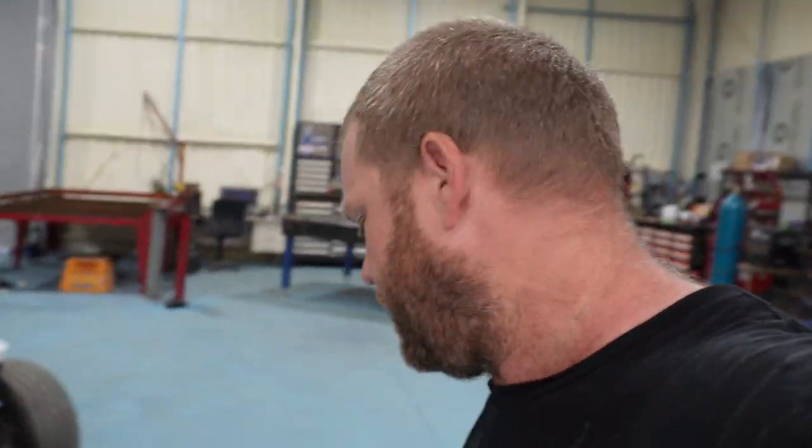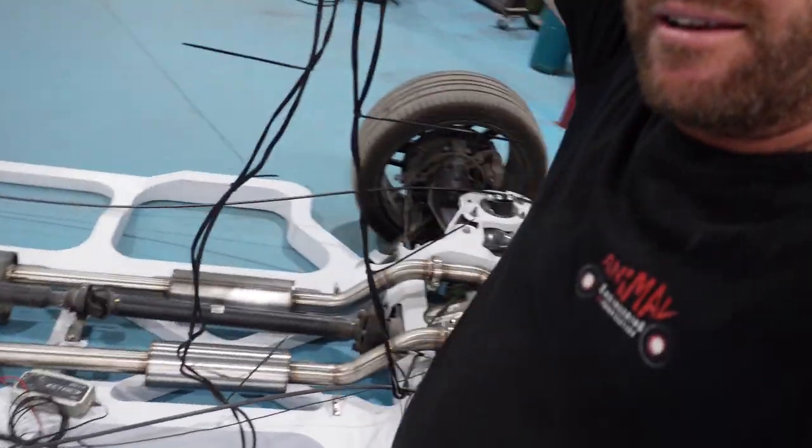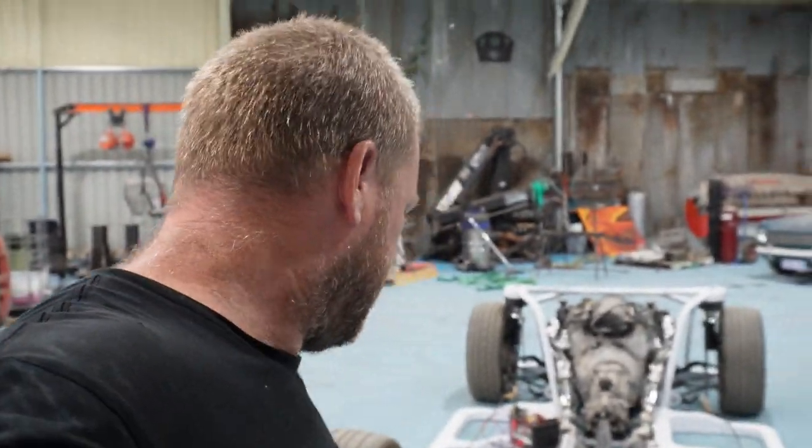Basically, with the battery sitting there is where I'm going to situate it, and you see all that extra wiring. So that's going to be a job I'm going to have to do: try and document how the wiring's run, chop it to pieces and make it as short as possible, just to go where the battery is. I guess they're designed as a universal thing: your battery's in the front of your car, your tank's in the boot, you can route it around wherever it's got to go.